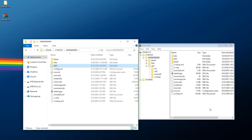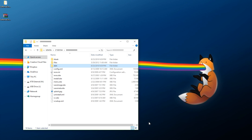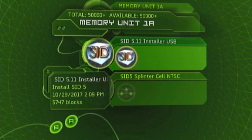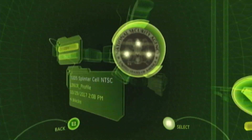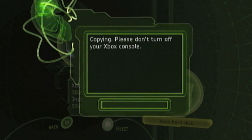At this point I have fully transferred every single file piece by piece for both the installer and our save game. Go to Drive, press Close, press Close again, go Exit, and safely eject your flash drive. Once ejected, pop it into your Xbox and boot it up without a disk in the drive. With the flash drive inserted, go to Memory — when it loads, go over to your flash drive and it's going to show Softmod Installer Deluxe, which is almost 6000 blocks, and also our Splinter Cell save. Copy and paste each one over to the hard drive and wait a few minutes for the transfer.